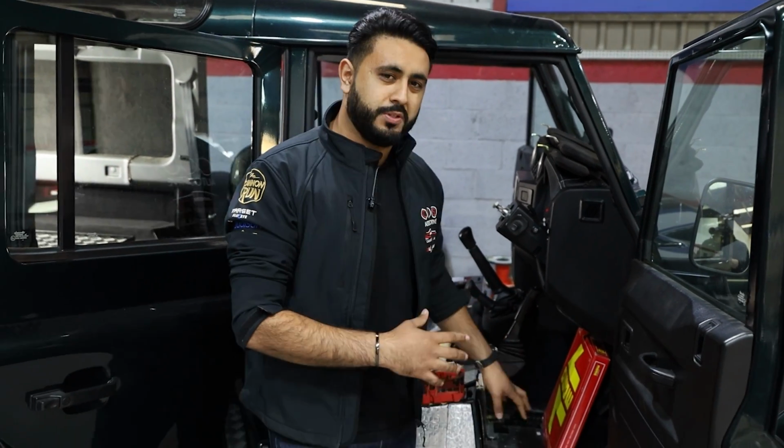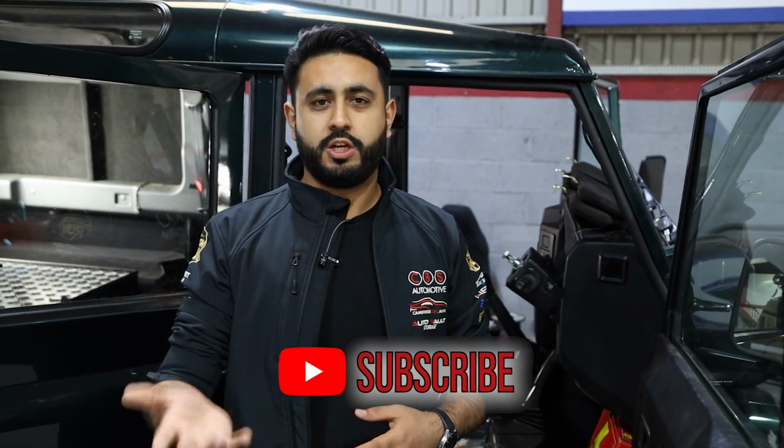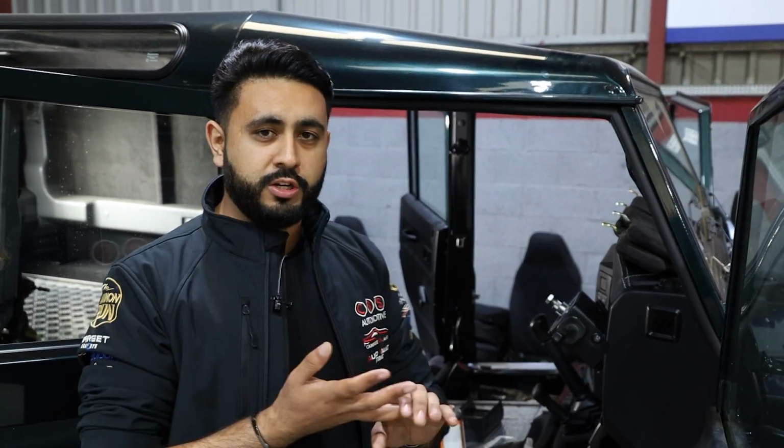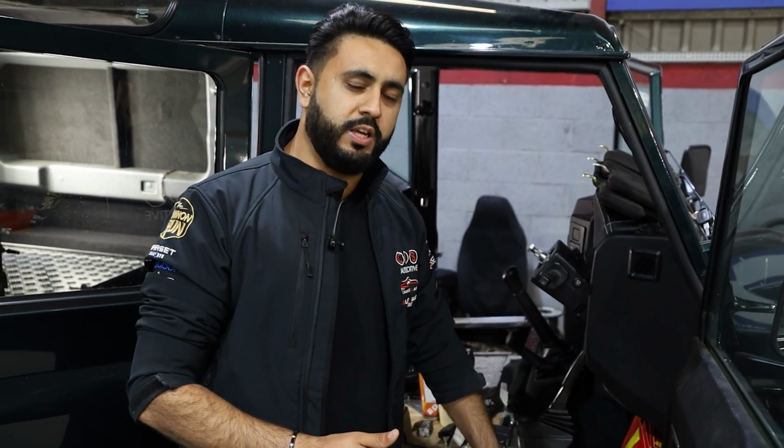The speaker going down here is going to be protected by a grille, because that's where your feet are prone to potentially knocking it. So they're yet to go in. However, this is all amplified off an Audio Control 6-channel amp, so the system is running what's called fully active. Six channels of amplification: 2 channels for the tweeters, 2 for the mid-ranges underneath here, and the last 2 running the 6.5-inch drivers in the under seats.